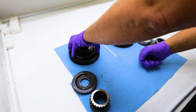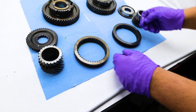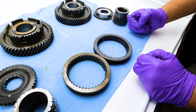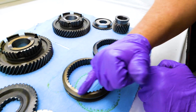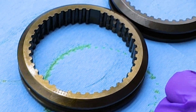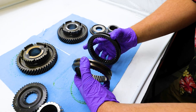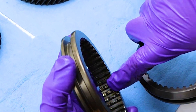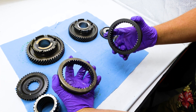We've got our synchro still in there — I'll leave that alone, we're going to replace that for sure. The next part is our synchro slide collar. On this same side you can see the sharp tips that are going to line up with our synchros look very good on both pieces. Flip it over — all of our edges here are nice and crisp on both sliders. That mark on there is something somebody put on to indicate which way it was going in this transmission, as it's been into once before. Inside, this doesn't have any wear marks at all, and this one has just a little bit of wear where those strut springs and struts push up against it to hold it into fifth gear. So I'm going to reuse that part — there's absolutely nothing wrong with that.